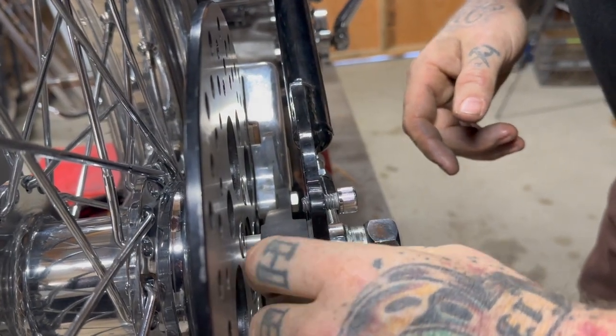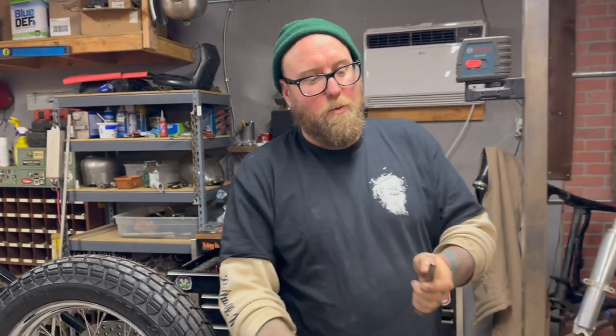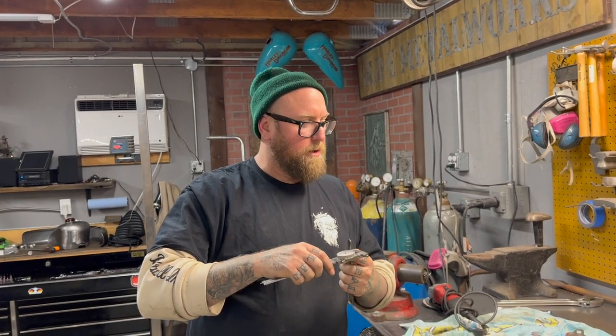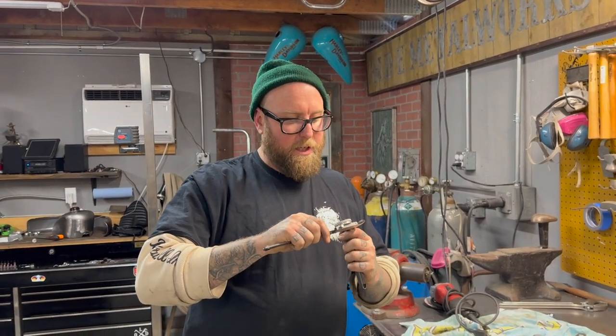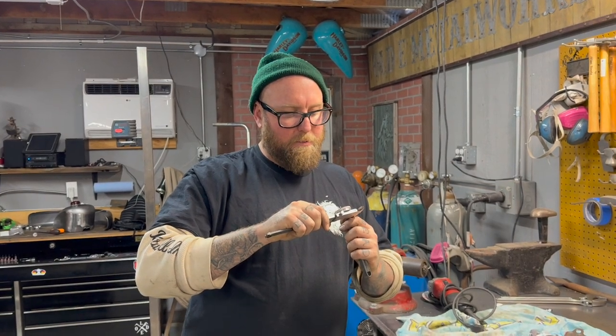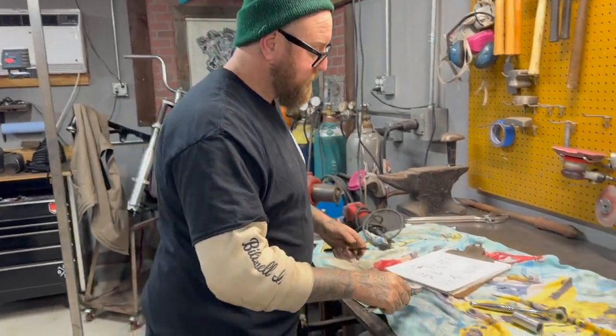There it is. So that's our space. Feeler gauge. Get thin boy. Now we can measure that out. Honestly, I think it's going to be a washer. I would usually just go find a washer and put it in there, a 3/4-inch washer, because that's probably what it's going to be. So this guy is 80 thousandths.